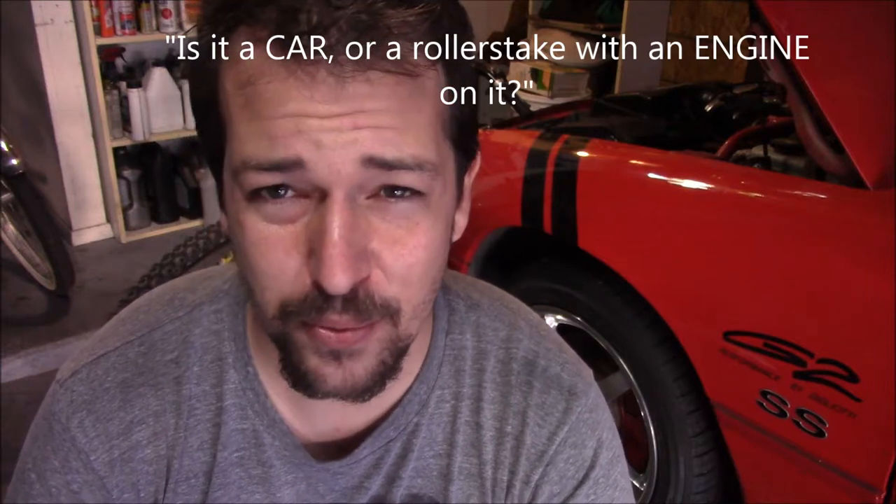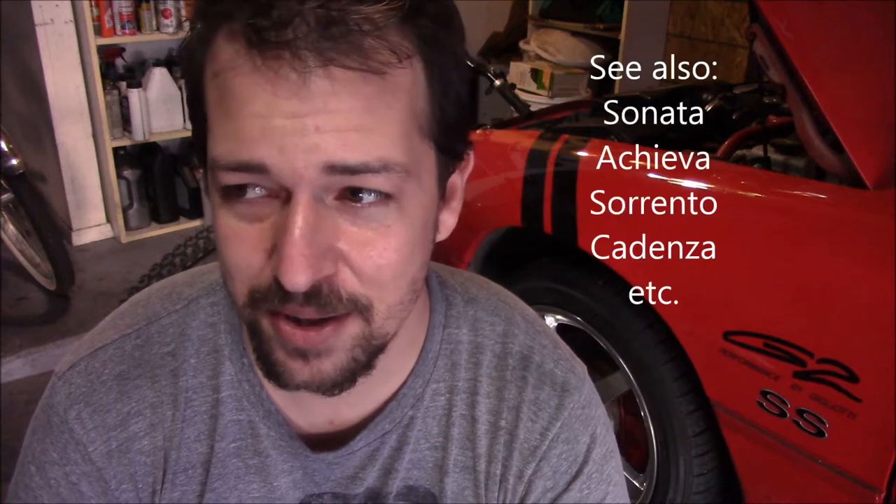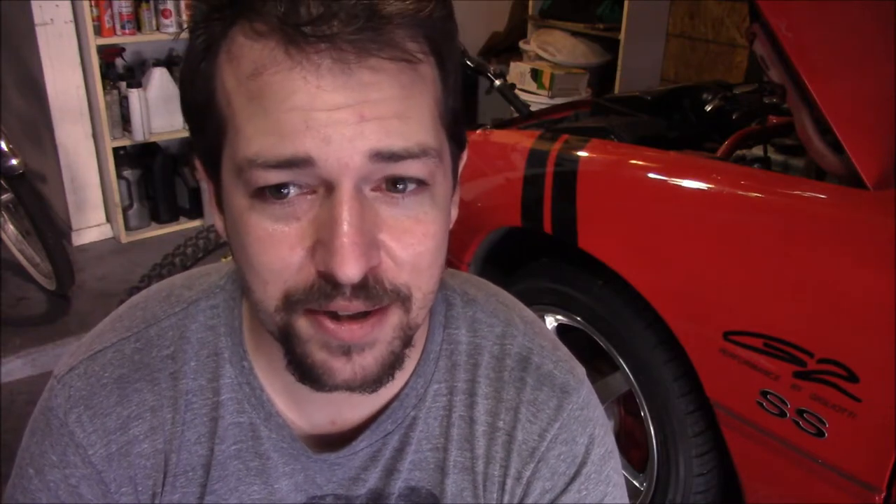It's a 24-speed. I got a really good deal on the bike, but it needed some work — namely a chain, tires, and pedals. I've already gone through and tightened up all the cables. They weren't too bad. I lubed everything up, adjusted the brakes, adjusted the shifting, and put new tires on it and tubes. So the only thing left right now is to put a new chain on it and the pedals.